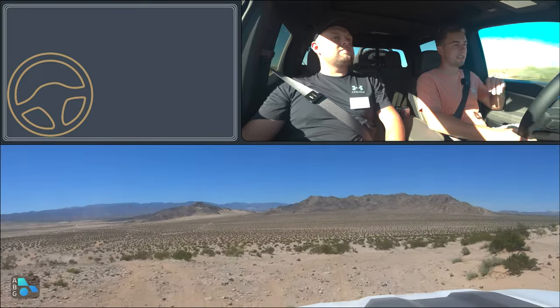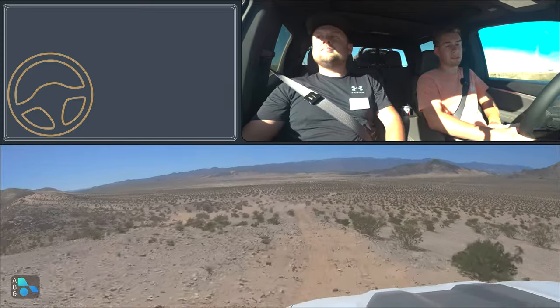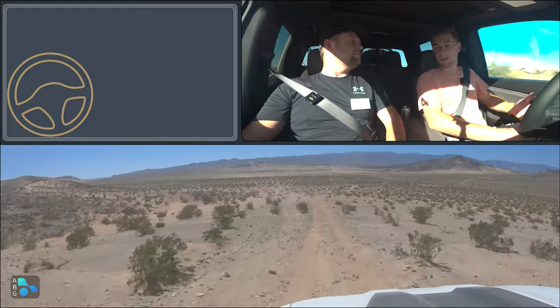So I'd say cut it in the middle. We're also sitting at 90 degrees right now for outside air temperature, and for a turbo motor that's not ideal, right? If it's like 30 degrees, it's going to be denser air and you're going to have more power.